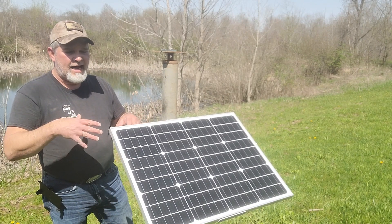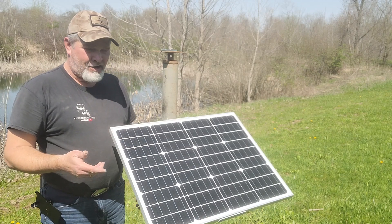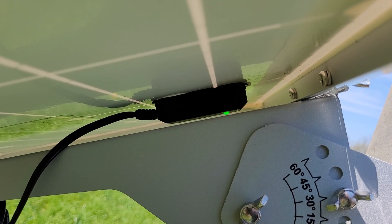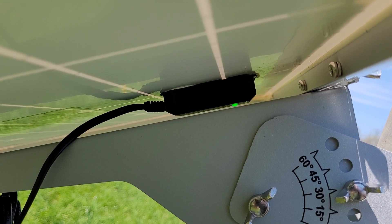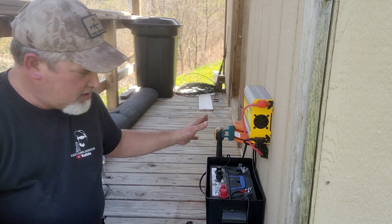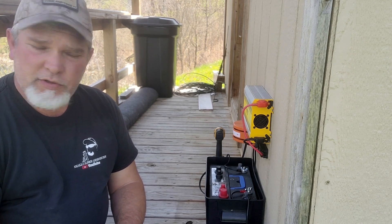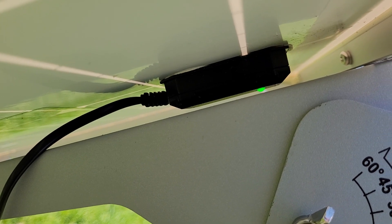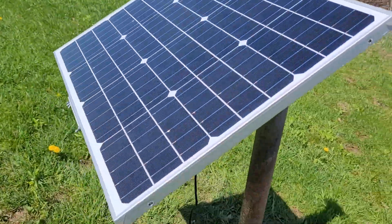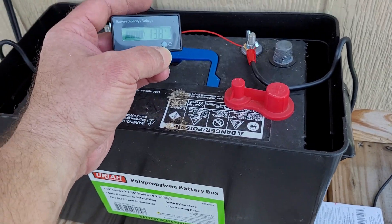One of the reasons I'm mounting this thing so low is that when it snows I can easily reach it to clean it off. I thought about putting it on top of the saloon, but bird droppings and snow would be hard to clean off up there. Down here I can just wipe it off. You can see the little blinking green light on the MPPT charge controller — it is working. Here's the moment of truth — let's see if anything pops and fizzes. It's all hooked up. Nothing to see, but it should be feeding juice to the battery. The light is now steady green.